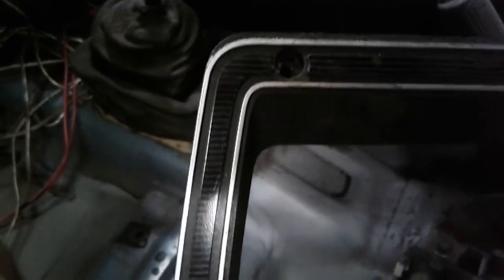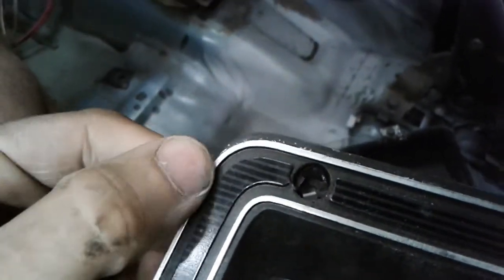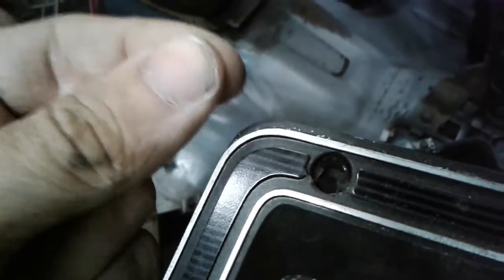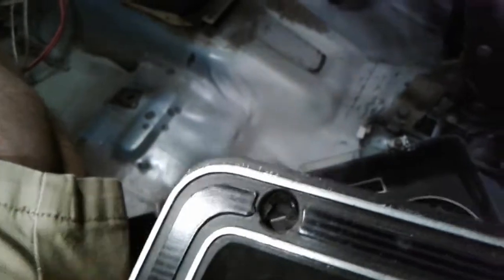But you can still paint all your trim. Testors metallic silver is good for those rings. That's what I use them for. So you just take a really thin brush, and you just brush it on there, and then you make sure you have a little paper towel that you can dip in some paint thinner to rub inside here. Whatever you get over the side, you can wipe off immediately.